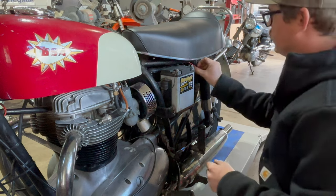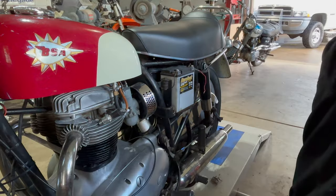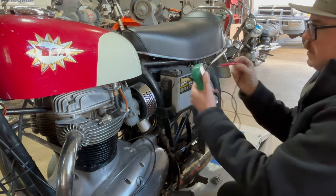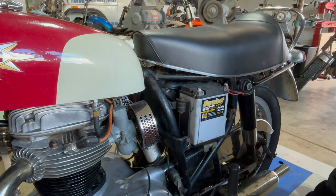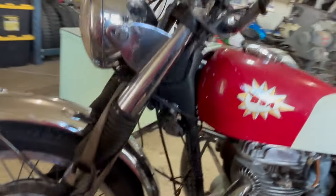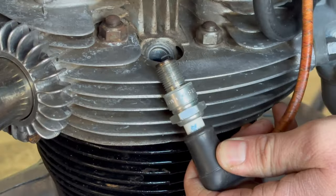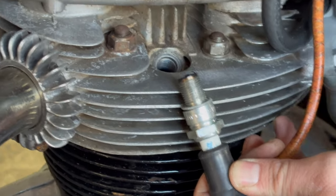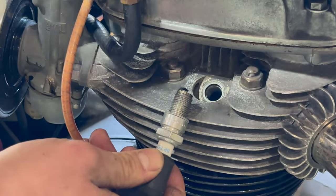This is loose — that's not connected. Let me turn that key off. Let's see how much this battery is putting out. 11.4 — not bad. I'm just in exploration mode right now. I'll go ahead and clamp that down so it's actually connected. Turn the key on — oh look at that, we got a little light. Now we should be able to test for spark. Nice — and I should check the other side too. All right, we got spark on both sides as well. That's great.